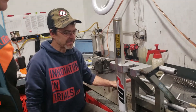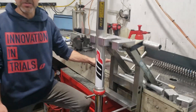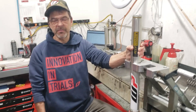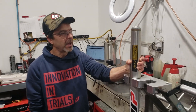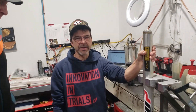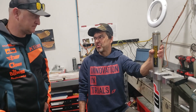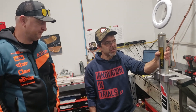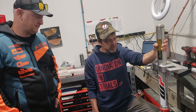We're using an old pair of shocks here. We're going to just swap out the springs — take out basically your stock springs that were set up for your weight for off-road, and we're going to put the snow bike springs in, which are much, much stronger and heavier, which you need for snow biking. So we're just going to do a simple spring swap on these.